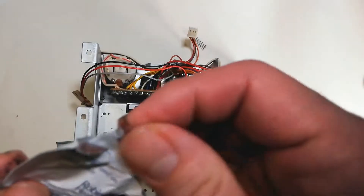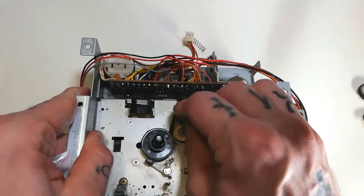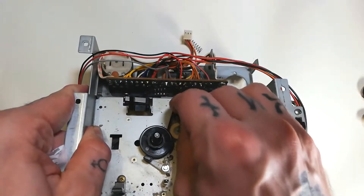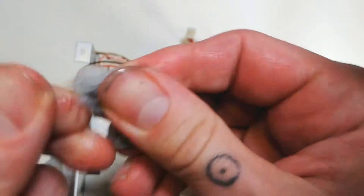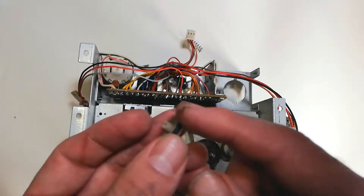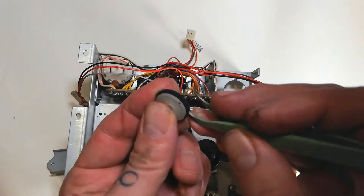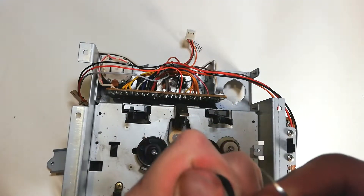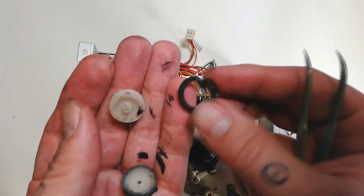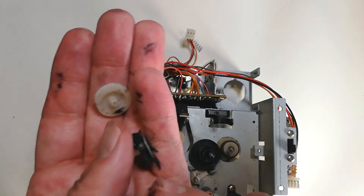I'm going to use the same isopropyl swab that I was using in an earlier video to clean the top of the pulley on the capstan motor. I'm just wiping the excess tar and stuff off my fingers. If it's not too gooey I can actually just scrape that out of there — use these tweezers or just some sort of sharp implement to get that out. I've pulled it out; I can just put that straight in the bin. I only need to do minor cleaning, but this one's a real mess.